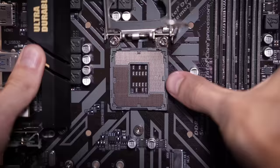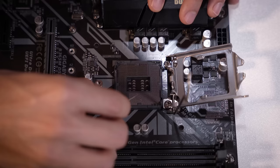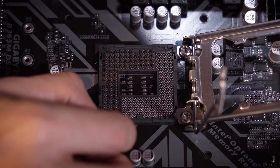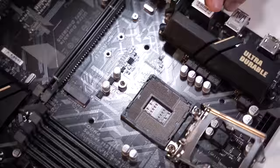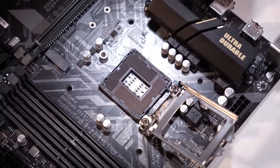This is all it takes, folks. I'm not saying this is the only thing wrong with this system, but just having one pin bent slightly out of place in these LGA sockets and your system will not post. I'm going to use a sewing needle like I usually do to try to bend this pin back into place — it looks like it just needs to be pushed a bit closer to center. I'm going to be very gentle here; bending too much will snap these pins right out of the socket, at which point you're pretty much done. The pin is definitely flimsy, but I think that'll do it — the pins look pretty straight now.